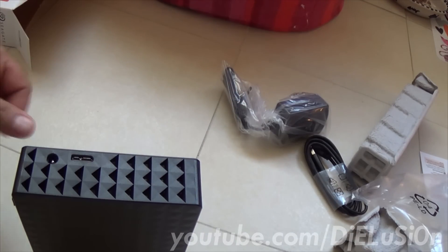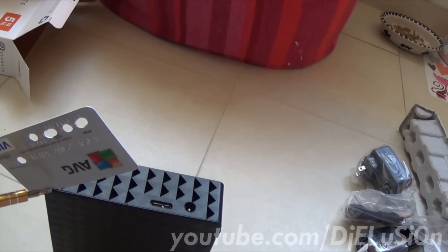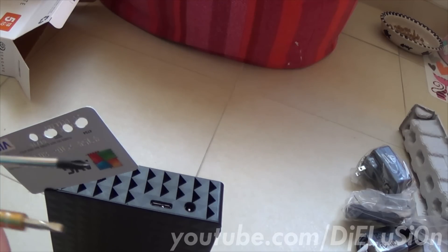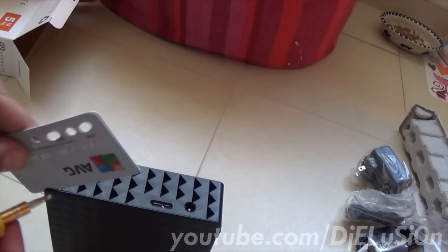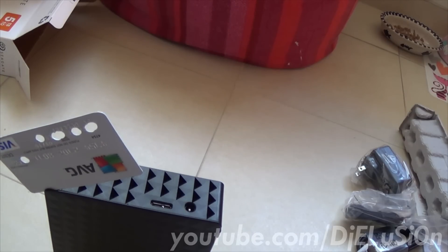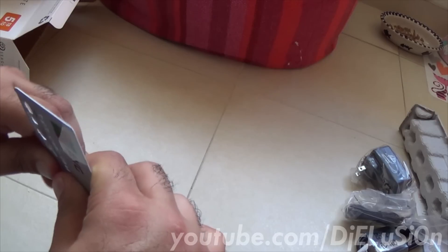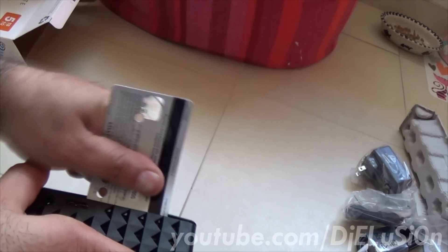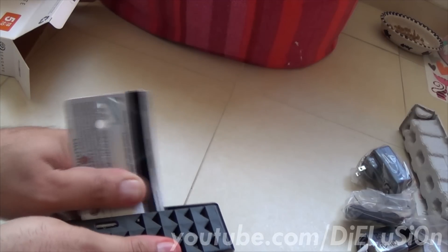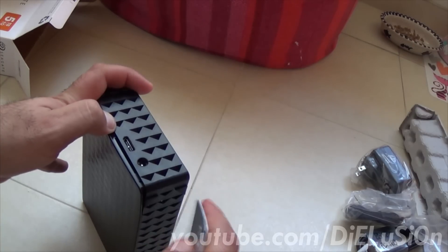This will pop up and you'll be able to extract the drive. It took a little bit of effort. What you want to do is work your way at one edge of the enclosure. I used a regular flathead bit from a screwdriver — it's a little bit smaller than your average Phillips bit. I pried the enclosure a little, then wedged part of a credit card in one side. All right, it's kind of loose at one corner — there you go, you heard a click. Once you have it loosened up, pry in there and loosen up the clips. You can see the back side is starting to open up more.